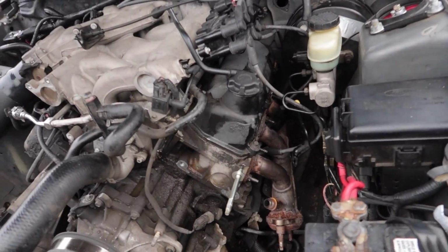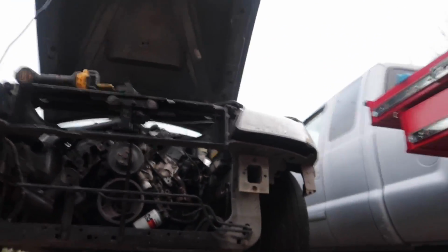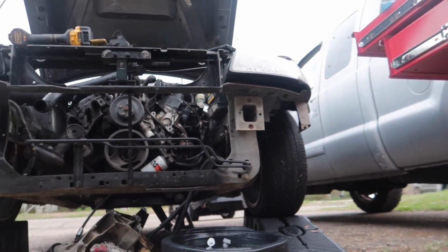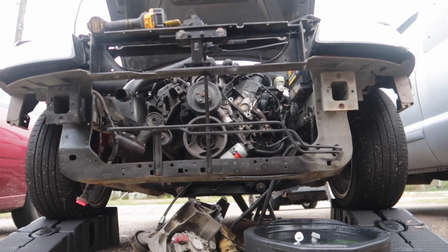Try turning this thing on again. I have the stock header on there. I just put that plug back in its place with the broken porcelain. I'm just gonna see if it will run without it. It probably won't even run on all cylinders anyways because there's no O2s, there's no EGR, and we're on stock tune. So not really dealing with the best, but we can make something work.